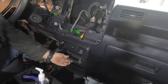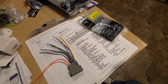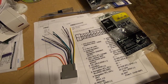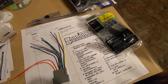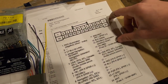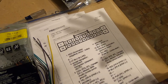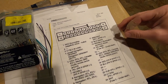Definitely start with too small a hole because you can't go backwards. When it comes to wiring for your aftermarket stereo and installation kit, the most common way is to use a double-DIN installation kit. I prefer the Metra family of products for wiring. I have here a wiring diagram for the factory radio connection in a 2009-and-up Ridgeline — in 2009 a lot changed. If you have a 2006 to 2008 Ridgeline you'll need a different wiring diagram and a different harness.